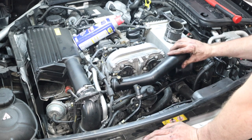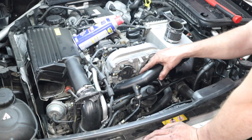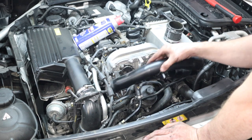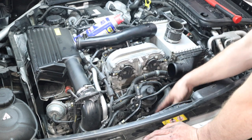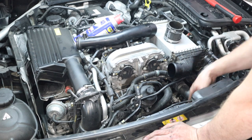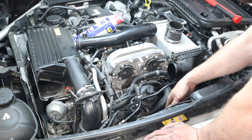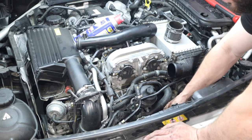There's a 5/16ths bolt that attaches that pressure connection where you have the O-ring. Pop this out before you do any of this because the alternator is going to have to come out right through here. I've already removed the alternator — it took me about an hour, never done it before. It's not all that difficult; it's just a matter of trying to get in everywhere to get it out.